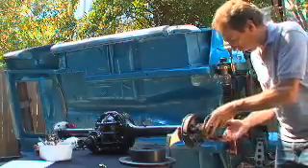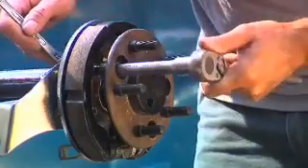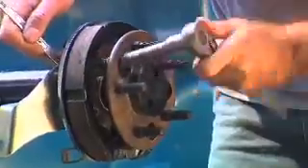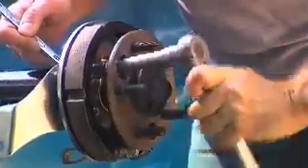Slip on the mounting plate and just hang it on the bolts for now. Slide in the axle and locate it in the spline — you might have to jiggle it a bit to do that. Then line up the bearing with its housing. As you tighten up the bearing retainer plate, it'll pull the bearing right in home. Tighten the nuts to 30 foot pounds of torque.